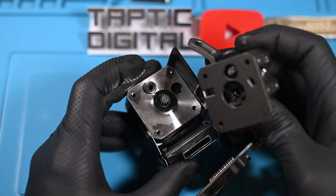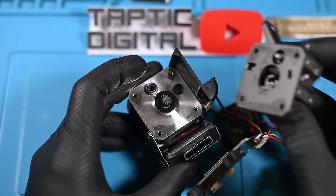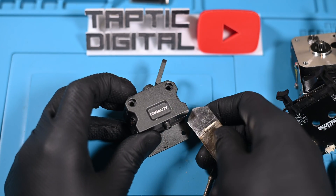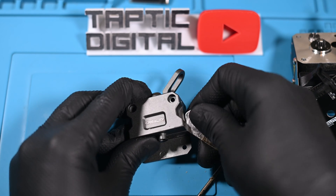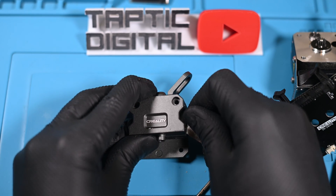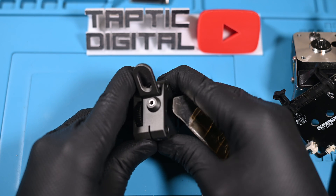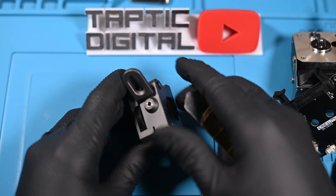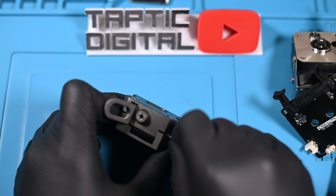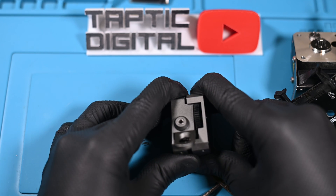Which was taking apart this gearbox, because it is not that easy. They are very much stuck together because the gears internally are very, very tight tolerances, and they are in line right now. To pull this apart, you need to grab a pry tool, but we want to walk these pieces apart — we don't want to pry one side up without the other side coming up too. These gears are really tiny, and I don't know what metal they're made of. I don't trust that metal, so we're going to be really careful here.